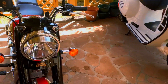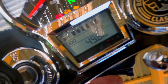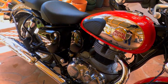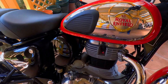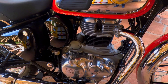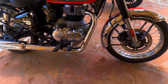We'll have a look here now, and I'll swing the camera and check a speedo reading. My speedo reading comes in at 49.6 kilometres, so I've done 50k. I've got one of these thermal temperature gauges here, so firing it on to the spark plug area — we're getting a temperature of 24°C. Down into the barrel area, again 24, and down in the bottom part of the motor it's around 23.7, so they're all on 24°C.